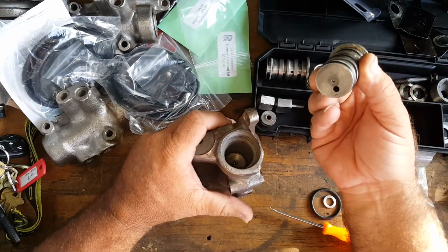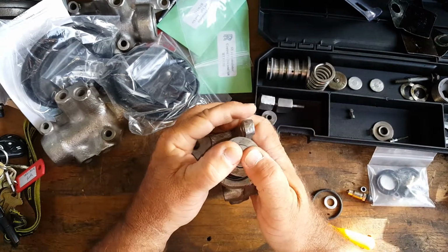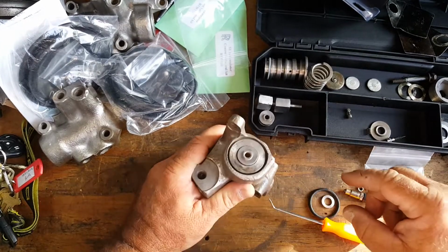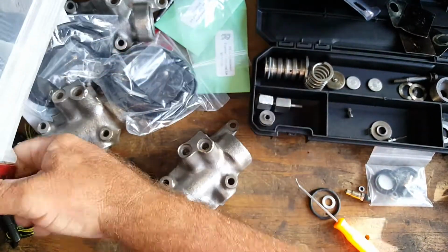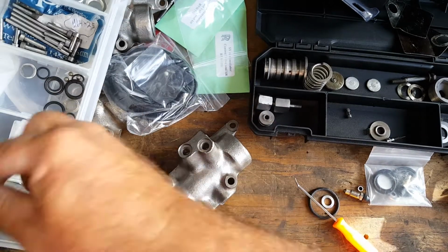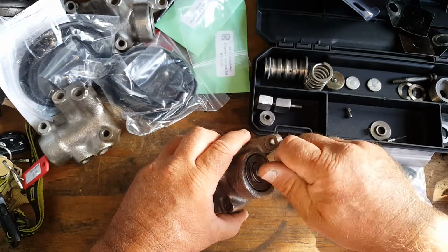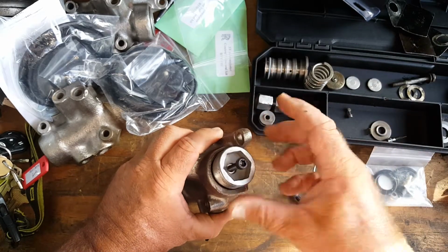We're then going to set our bobbin. Now that pin will ride right on that ball bearing there. So we go ahead and we slide that down. We can compress it down in there as such. All right, so now what we need to do, we have to get this to compress down in there a little further. So what we have is a screw that's going to go in there. And we put this in there. This actually screws in. We put it in a vise and we compress it so that we can put it inside. And this actually will screw down on there.